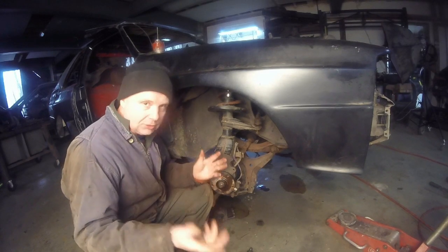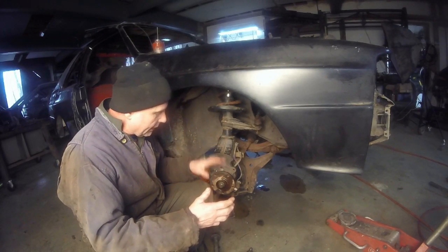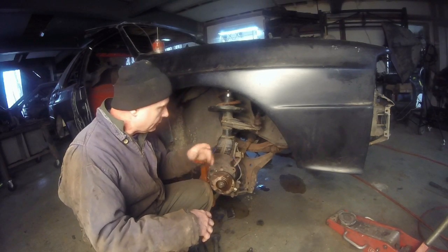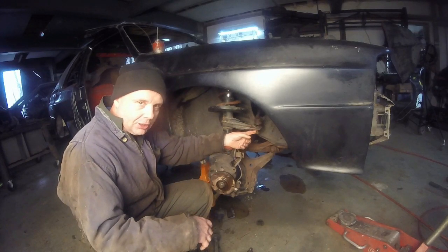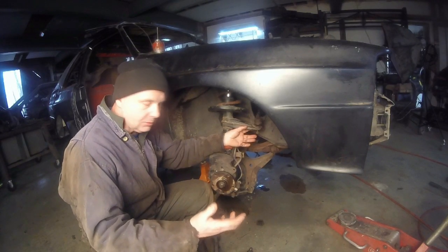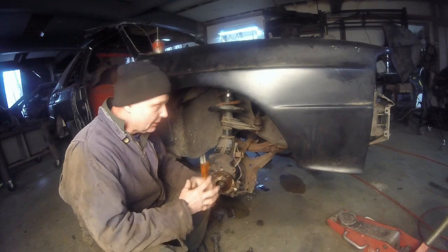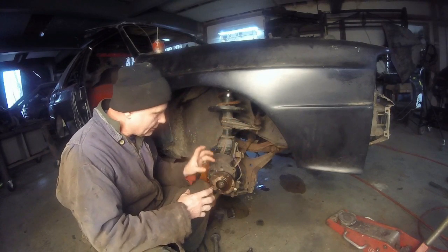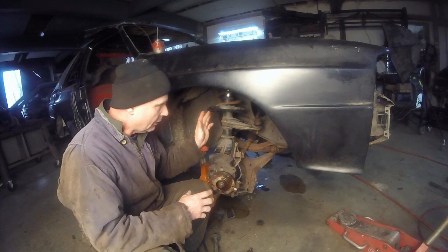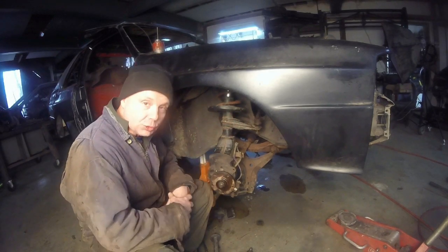So what I did, it's rough, but I figured it out: I have one of these struts without this hub assembly, and a 4000 Quattro without the hub assembly. So I measured off the bearing surface to where the tie rod end comes out with a framing square. On the 4000 Quattro, it was roughly 5 3/4 inches, and on this, it was roughly a little over 7 inches. There is your track. So this hub is further out than the actual 4000 strut. That's why we can use the Coupe GT inners with Passat outers, and it'll bolt up and it'll track.